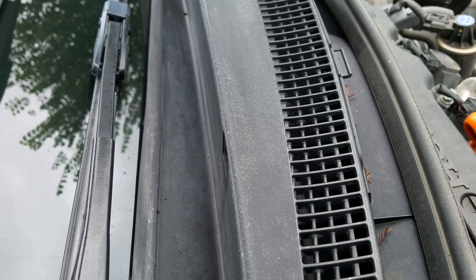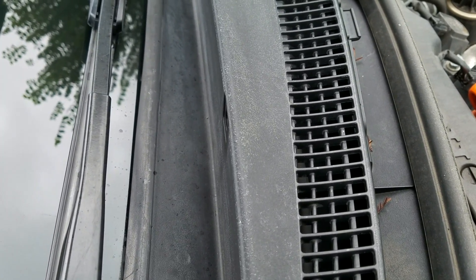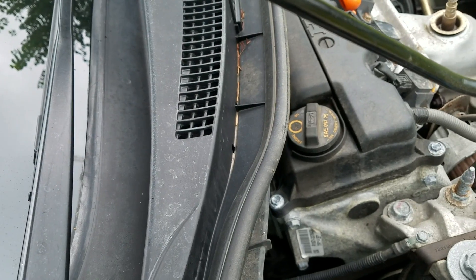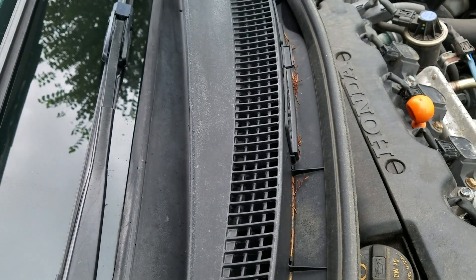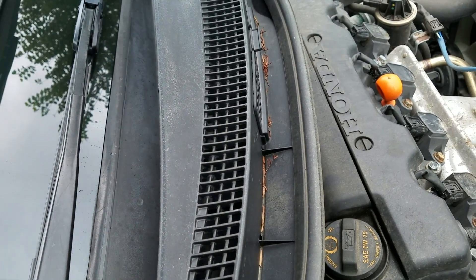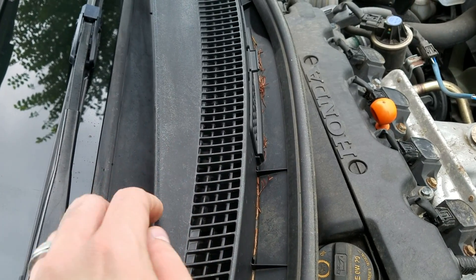This is what it looks like after I went over it once with the heat gun, just a little bit, and it looks quite a bit better — it's not perfect, but it definitely works. I should go over it again to make sure to get the rest of the white stuff out, and then add a little bit of automatic transmission fluid after it cools down to soak it in.